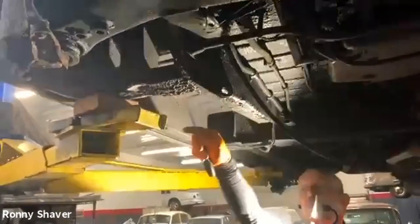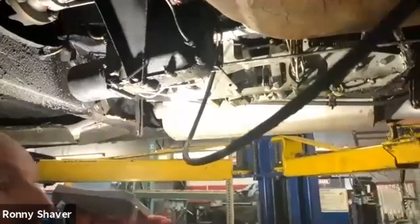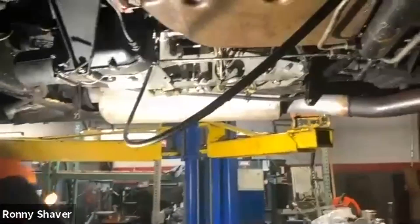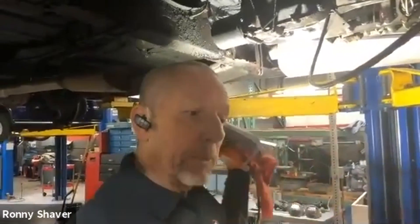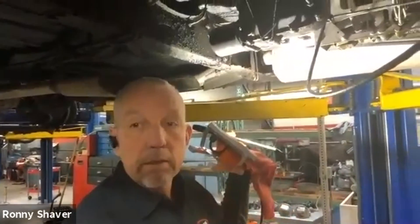If you come over here, you can see there's holes in the box right there designed for the pedals to come through. So this rat trap — here's the brains of the braking system, other than just building pressure. The accumulators build the pressure. They're called accumulators because they accumulate pressure and have it ready to use when you need it.